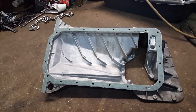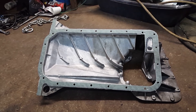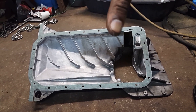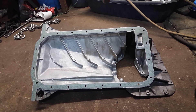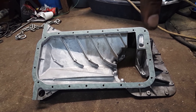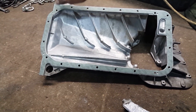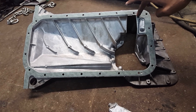Now I've got the gasket on. Once you get the gasket onto the oil pan itself, it's always good to give it a few minutes — say two to five minutes. That will help dry the silicone so the gasket sticks to the oil pan a lot better. You're not fighting the gasket because you don't want any of this to move around or slip. It makes installing the oil pan a whole lot easier and helps give you a better seal for everything.